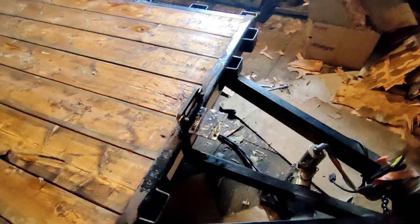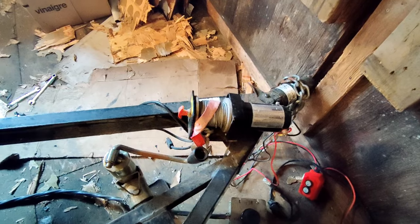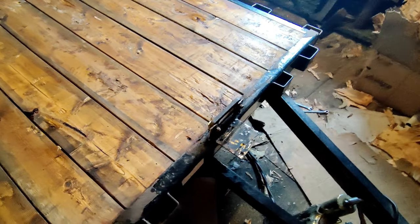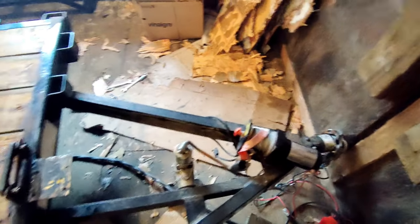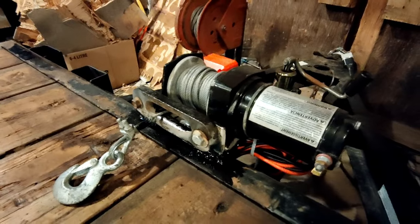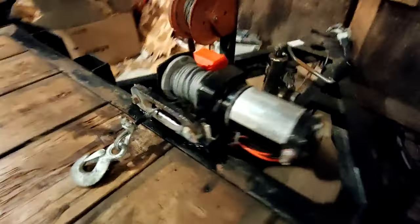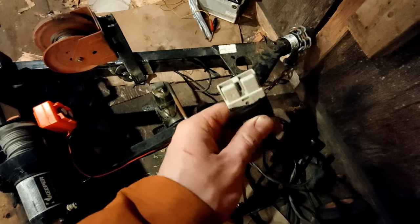Okay guys, one thing I added on to the trailer is a winch mount here - loaded on nice and strong for my 2000 or 2500 pound winch. Just turn it on the trailer to winch up a quad or something small. I welded that up. I'm going to throw some paint on it and then bolt the winch on. Got the winch bolted in - well, welded in and bolted. Got a cover plate. Hooks up to the winch controller. She works, and I can just connect it to my truck or any vehicle with this adapter.